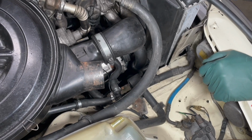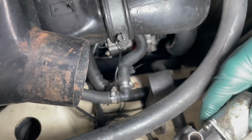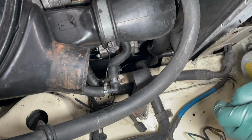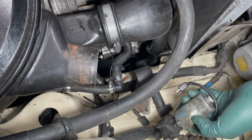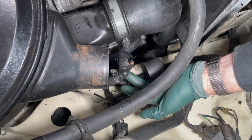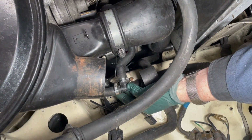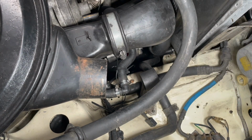Now look what I've done here with this W123. Back when I tested this pump with 12-volt power to this plug, it would not even run. So I took it out of the system because at the time, these were not available brand new. And look what I did. I put an elbow fitting right there and clamped it up. Did not need to cut the hoses, did not need to change anything, just in case I was going to find later on a good pump.